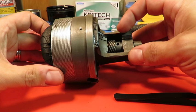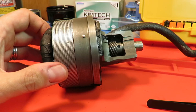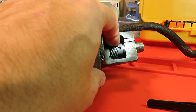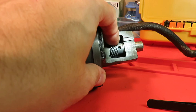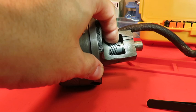And so there are two screws that go in here. This is the A side and the B side. And the flat of the shaft is going to rest under the A side. And what I'll try to do is show you that it's there now. And as I rotate the worm gear or the shaft, you see it there. You can see how there's shaft, shaft, shaft, and there's the flat. I think that comes through on the video, I hope. Do it one more time there. You can see it open up there. And there's the flat. And so that's where the side A grub screw is going to go, which I have here.